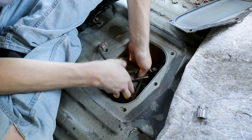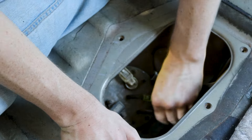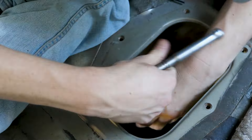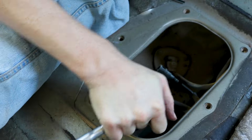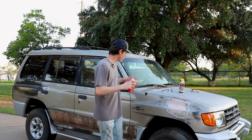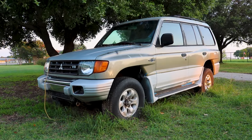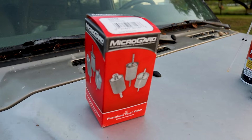It's time to install the fuel pump assembly back into the car. We just have to make sure we secure all the hoses and electrical connections back where they're supposed to be, and tighten down all the nuts around the fuel pump assembly to ensure a good seal between the gas tank and the pump. After replacing the fuel pump, the car started right up — and that explains why it's right here instead of parked in the grass under the tree where it sat for the last six months. But we're not done quite yet because we need to finish off by replacing the fuel filter.